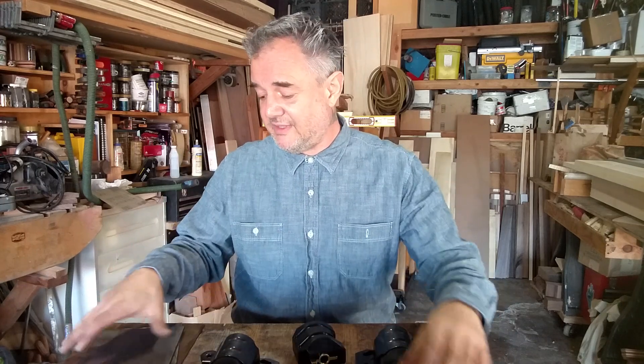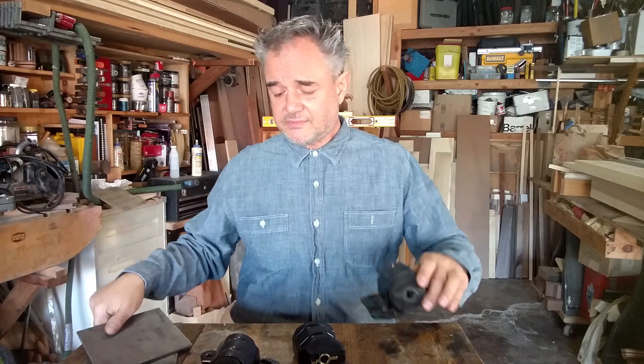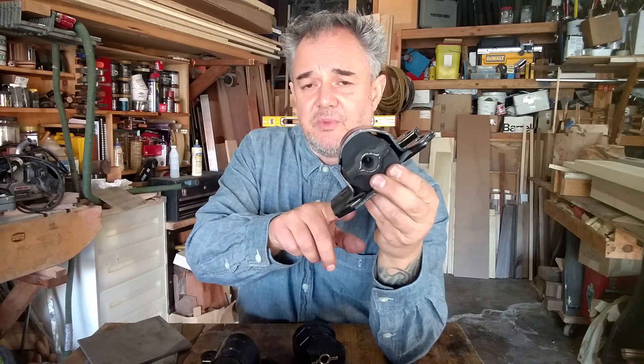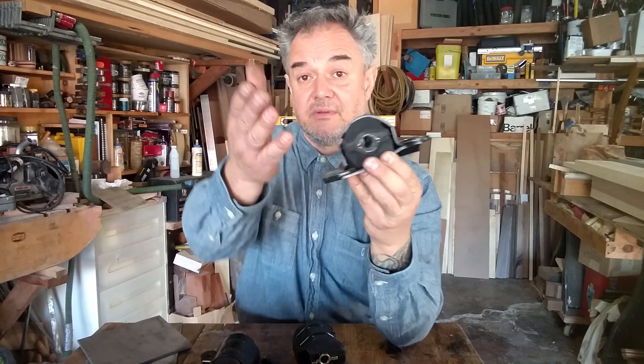If you have any information on this, if you've done this, gone through this, or have a better idea, let me know. One more last thing — I've got some steel plate and I'm going to trace out the bottoms of these mounts and make my own custom plates in eighth inch, three sixteenths, and quarter inch. Because the mount sits on an angle inside the vehicle, I'm thinking it might be smarter to make a plate that just goes underneath the two mounting holes and lifts it that way — that might give more height than a full plate. If you have a better idea, let me know. Hope this has been helpful — have a good day.